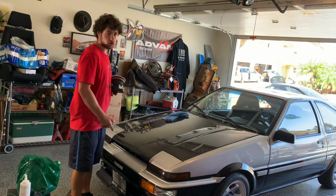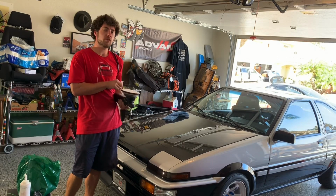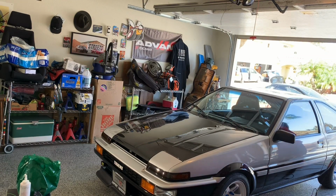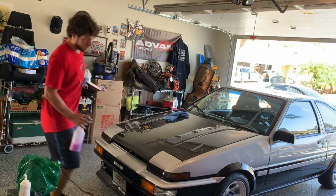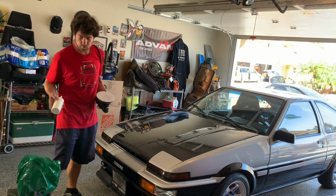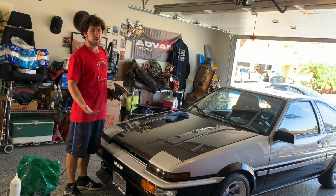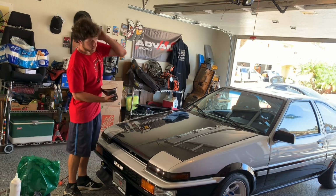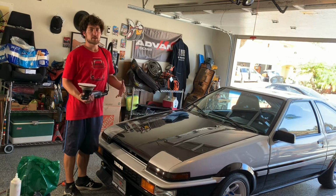So now that I've kind of broken down the abrasives in this polish, I'm actually going to do something. I just cleaned out the pad, so now I'm going to do something that Shine Supply recommends, which is to take Shine Mist and give your pad a little spritz with that, and then I'm going to do just the tiniest little dot of classic cut now. I'm going to put this back on here, and the wetness is going to help to reactivate some of the abrasives so that I can get a little bit more working time out of my compound. That way, before I reload the pad, I'm able to do a little bit more, and also it's going to help to finish out nicer.